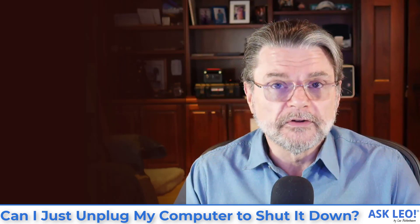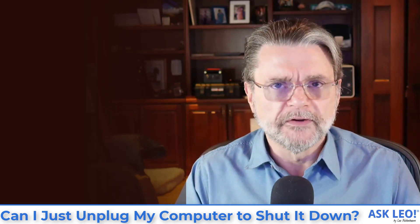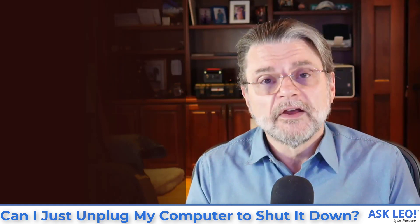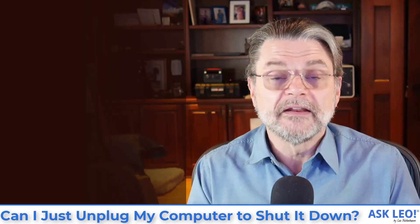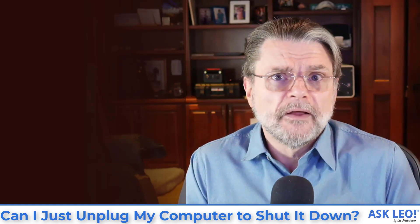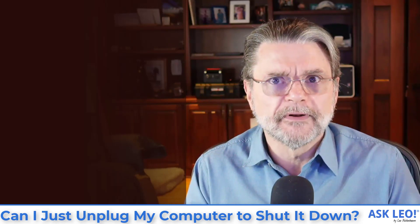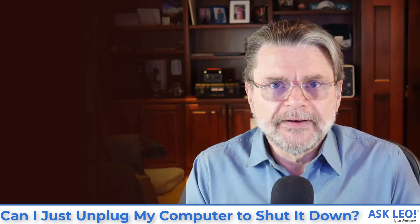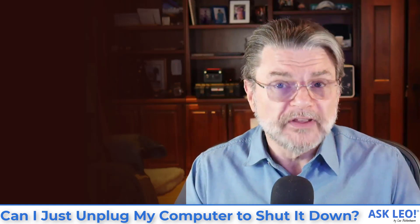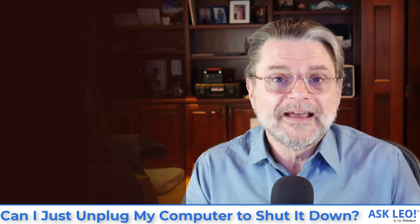Now, the one thing that wasn't clear from your question is, did you try to shut down in Windows? In other words, if your computer responds to your going Start > Shut Down and it goes through the shutdown sequence and does everything it's supposed to do, it may turn itself off so you don't have to unplug it. If it goes through the motions of shutting down, but at the very end you see nothing but a black screen with the machine still running, then you may actually be OK to pull the plug. Again, don't recommend it. But Windows was given the opportunity to shut down cleanly. So if at all possible, make sure to go through the shutdown in Windows to save everything to disk and give it enough time to finish before you pull the plug.